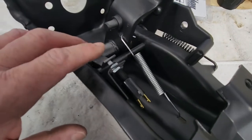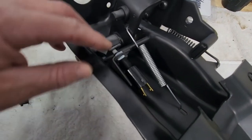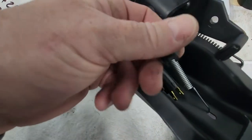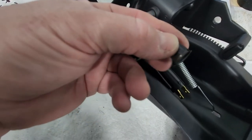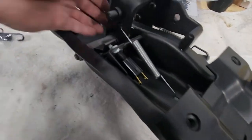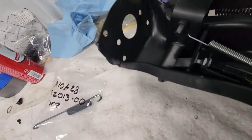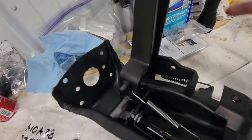I just put the small spring on there to get an idea of what I need to measure. The brake switch is installed. There are two ways to do this: the brake switch came with lock nuts that you can thread in on both sides and adjust accordingly. Alternatively, depending on your pedal box, you might have the original clip — in which case the switch just slides in and locks into those little teeth, adjusted through that. I opted to set mine up with the lock nuts for now, though that'll probably change once I get it hooked up to the brake booster.